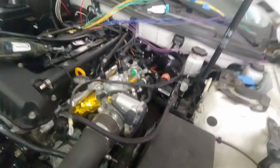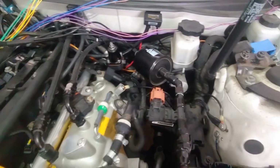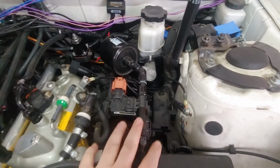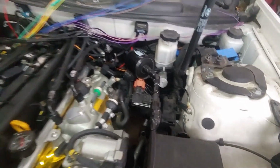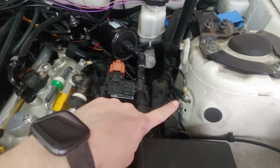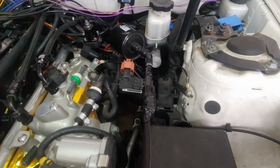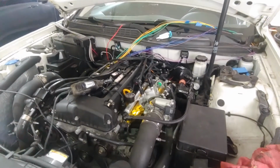And you'll have just about the best ground setup that you can have for this, now that we have essentially gone through every ground, buffed the paint off, sealed them with silicone grease, and we shouldn't really ever have a grounding issue after that.